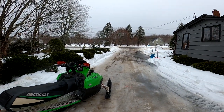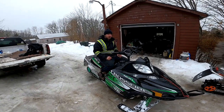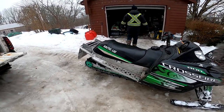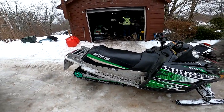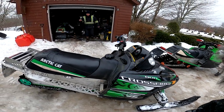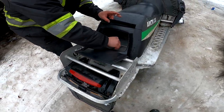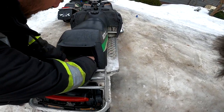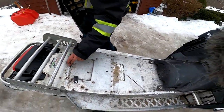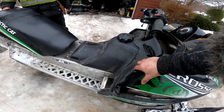And the thing is just ripping — it works great! All because of a stupid tail light. With two-stroke sleds, that bogging symptom can be a lot of things. Instead of staying old school and running the wires through the chassis, they've got the wires run through the tunnel where they chafe on everything underneath. So that was the plug we unplugged — and it works.